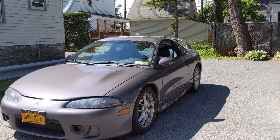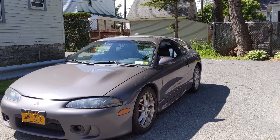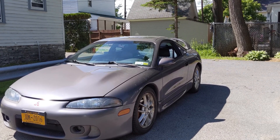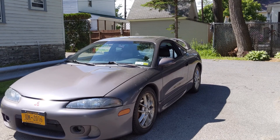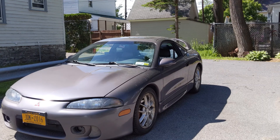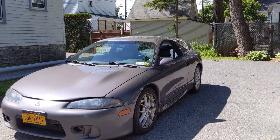Welcome back to the channel. Today's issue is a little problem with some lights. Driving down the road, my headlights start to dim — I hit the gas they get bright, I let off they dim out again. I pull out the multimeter and start testing, and it turns out that my battery is not being charged properly, so that leads me to believe that the alternator is faulty.